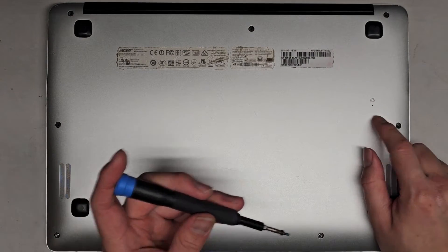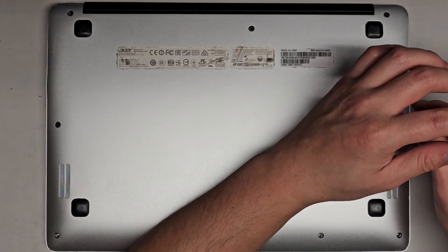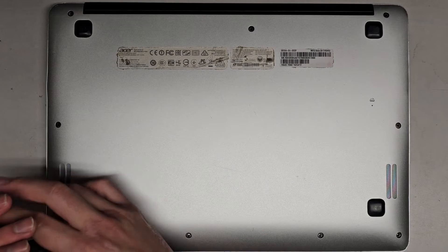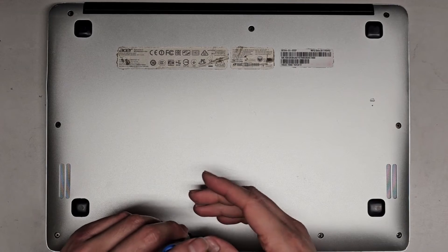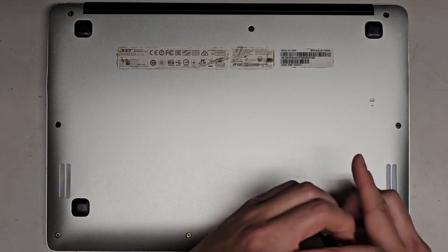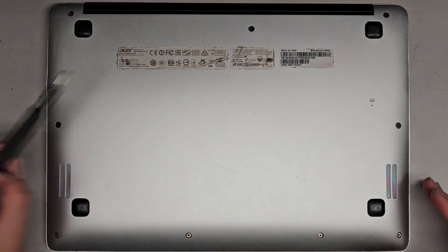One other thing — there's a little hole here. That's a battery reset hole. So if your computer is having issues booting up or powering on, you can try using a folded-out paper clip, a pin, or a SIM eject tool — whatever fits in there. Press and hold it, you'll feel it click. Hold it for about 15 seconds and then try to power it back on. If you're lucky, sometimes that'll fix the issue. So that's pretty much it — last two screws and we're done. Thanks for watching. I'll see you on the next one.